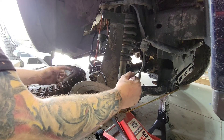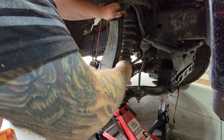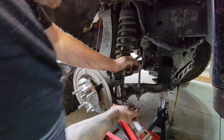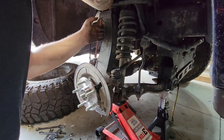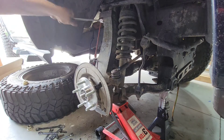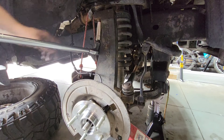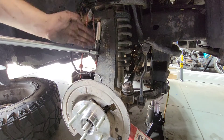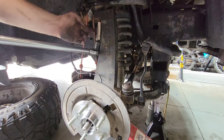We've already hidden the bolts to the hub assembly and torqued those. Now we move on to the tie rod end and upper ball joint. Torque the upper ball joint to 40 foot-pounds. I have a wobble extension on here but I'm staying at 90 degrees — if you use extensions or any angle, you must stay at 90 degrees or you'll change the effective torque spec.